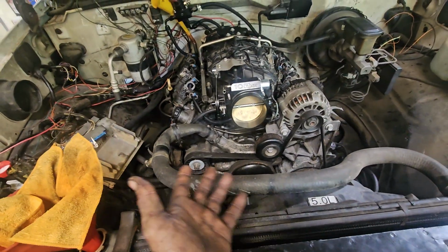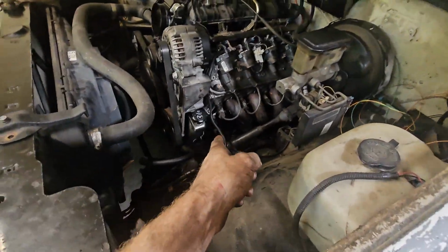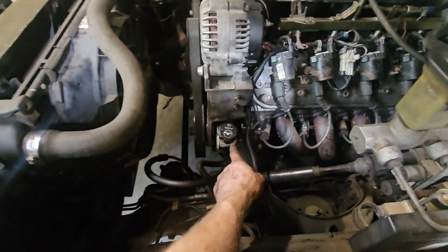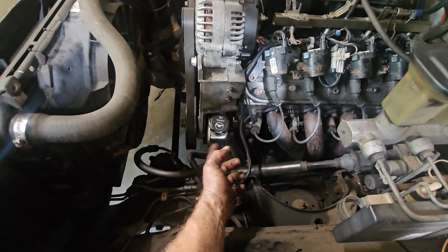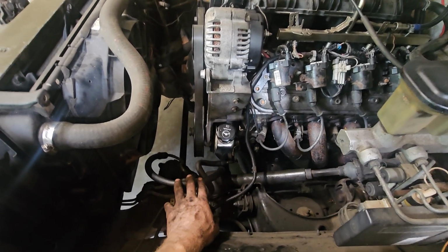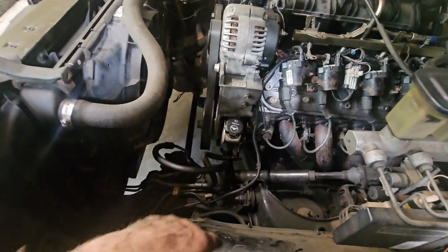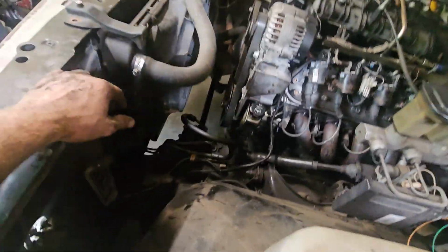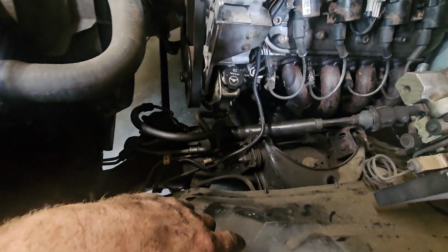Then all I did was put the truck accessories on here. And then for the power steering, what you do is you take your fitting off of the 1-inch fitting that screws into the pump. You take it and the hose that came out of your swap vehicle, and then screw it into your new pump. So then that remedies that situation. And then obviously the return is not really a pressure hose, so you just need to seal it up.